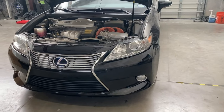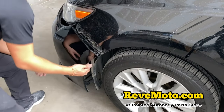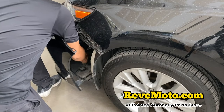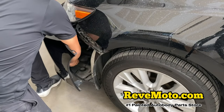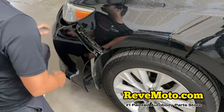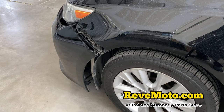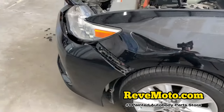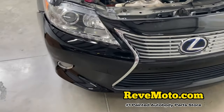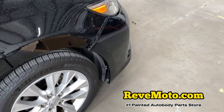Now what I'm doing is going to go ahead and line up the sides. All I'm doing is pulling the bumper to the side and then I'm going to grab that wire harness right there and go ahead and plug it into place — you should hear that click. Now the fog light is in place. Now we're going to go to the other side. The other side has two wires basically — those two wires are going to be your sensors and also your fog lights.